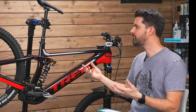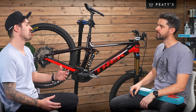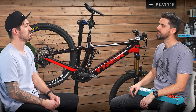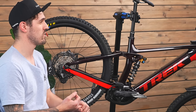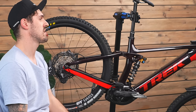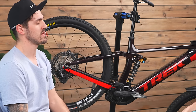What tips have you got for anyone that might want to wrap their bike but is wondering about it? If you are wrapping a used or ridden bike, the biggest thing is just to make sure it's nice and clean. Wash it down thoroughly. Make sure all the areas that hold grease - around your rear axle, around the bottom bracket, your headset - really give it a good wash to make sure nothing's going to come out and get underneath the wrap and contaminate it.